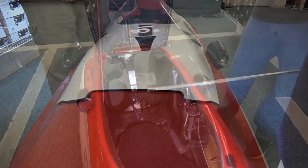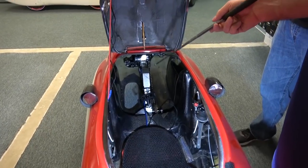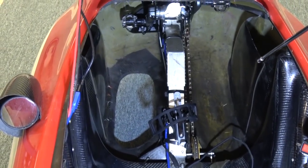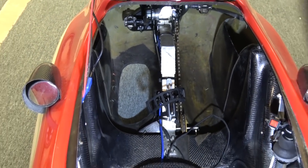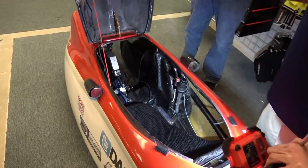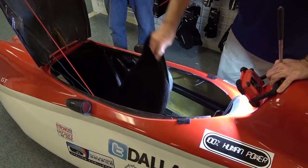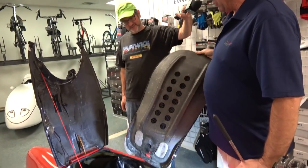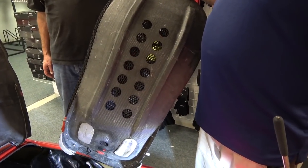When I flip this lever the other direction and lower it, it flattens out completely and snugs down — no more opening for air, and more aerodynamic. Another unique feature: one footwell is open and one is closed. Most velomobiles have two open or two closed, but here the designers decided one was aerodynamic and you can velcro in a cover for the other. The seat design is also different — rather than being mounted on posts with adjustment pegs, the seat here actually sits directly on the frame and just lifts straight out. You'll also notice I drilled holes in the back for ventilation.